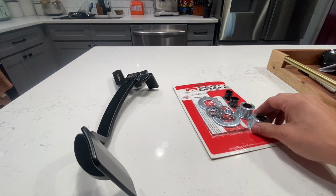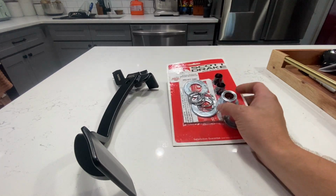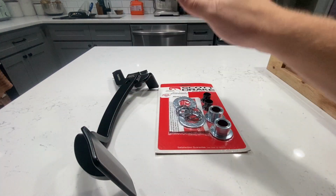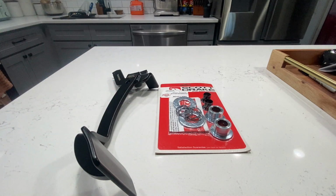First thing we're going to do, starting this process, is getting out the old clutch or pedal assembly, adding in the roller bearings, and getting the clutch lever or clutch pedal actually in. We just got the motor and transmission out, so after we get this in, hopefully it won't take too long, we can go ahead and get all of the components for the hydraulic clutch assembly in the engine bay, and then at that point we should hopefully be ready to put everything back together.